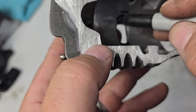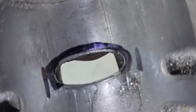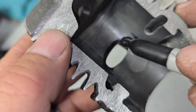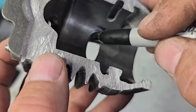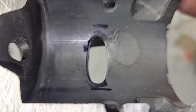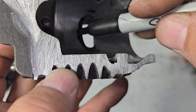And why? Because you're going to have to reprofile your exhaust port with a Dremel, with a grinder. Now, if your exhaust port is the stock width and your chip is here, you might not be able to grind it out high enough. Basically what I'm saying here, Doug, is you need to grind that chip out. If your chip's like that, you're going to have to grind it away and get that chip out of there and make it match fairly nicely.